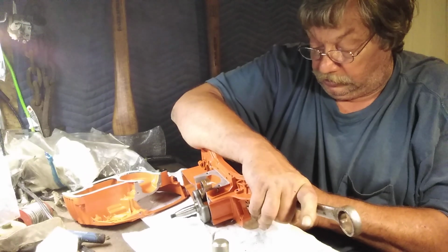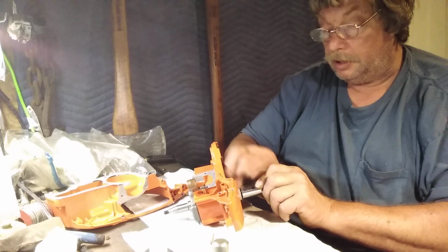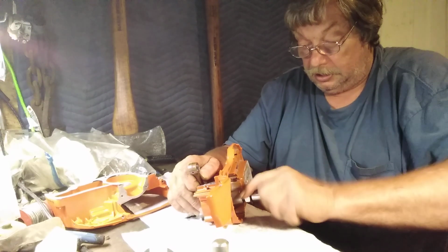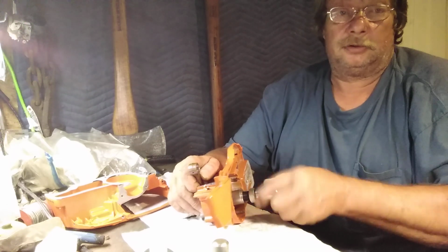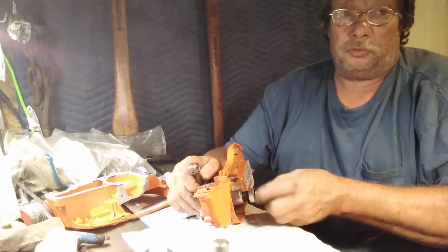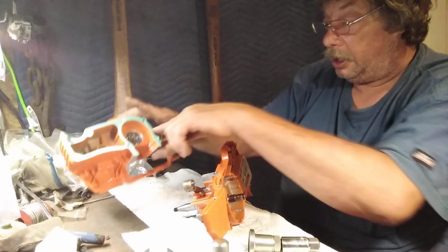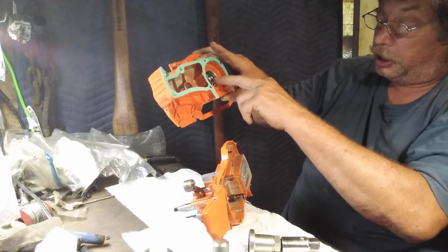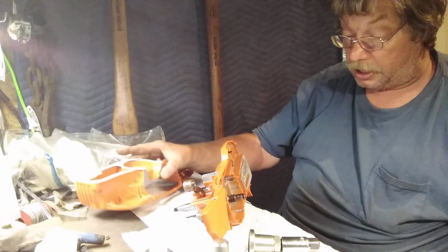Back my nut off. Okay, nut's backed off. And I unscrew that from the crank. Why would you not do that? Why would you not use that tool? Why would you try to reinvent the wheel? Don't do that. If you've got nothing else and want to use some washers and all-thread, make sure that you're supporting that bearing on the outside right there. Don't load that. When you put the bearing in, it's okay. It gets low when you're pulling the crank, but it's not going to hurt anything, okay?